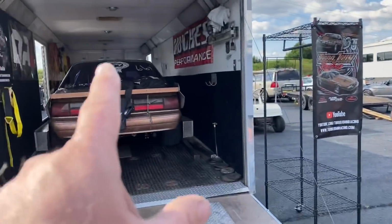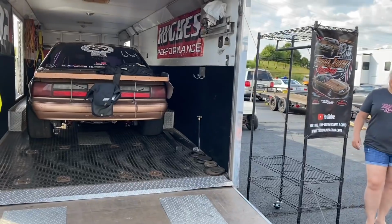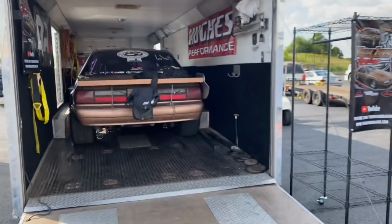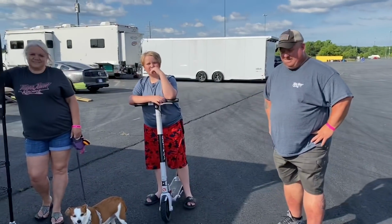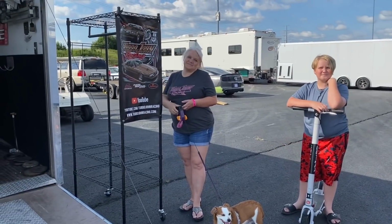With this transmission in the motorhome, it was blazing heat. You're supposed to put it in neutral when you stop at stoplights if it's for an extended period of time. So we were sitting there, transmission temperature gauge, boom, 300 degrees. Luckily we made it in without blowing a seal and burning somebody with hot transmission fluid. But we made it, so we're here. Now the fun begins.